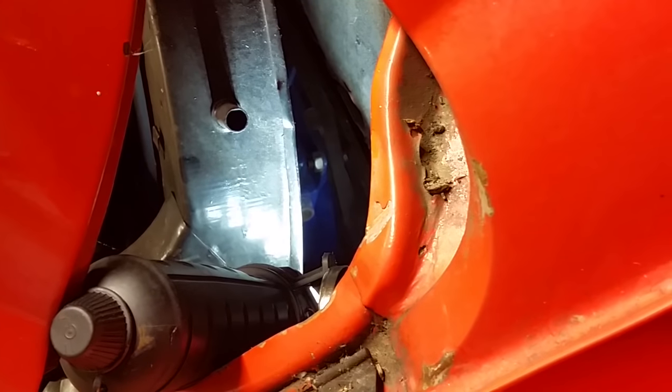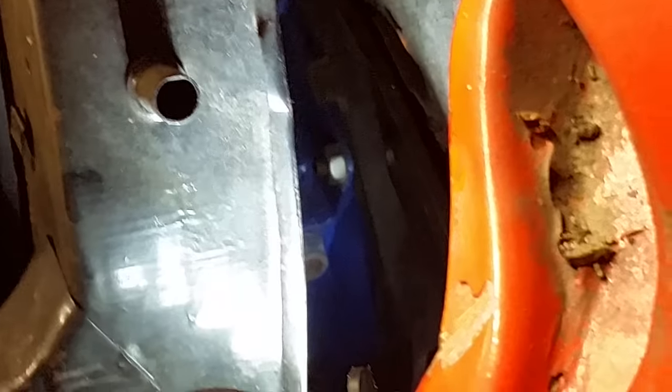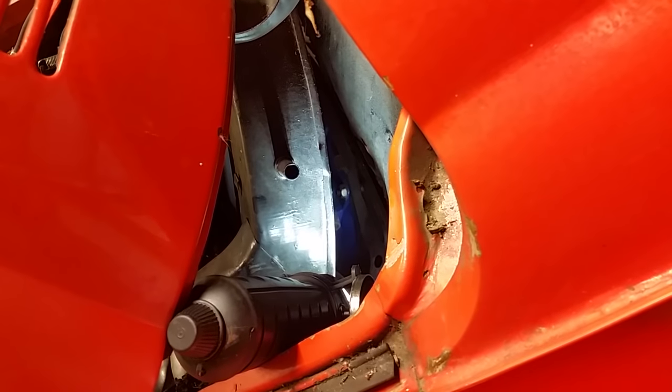You can see that shiny nut on top - that is one of the engine mount bolts and also your top starter bolt. Take that off and the starter will come off - it's a 17 millimeter. Once you get that top bolt loose the starter should just pop right out. Also while you're down here, get these heater cables out - these little cables control your heat inside your Volkswagen, the on/off that lets heat go into the cabin.